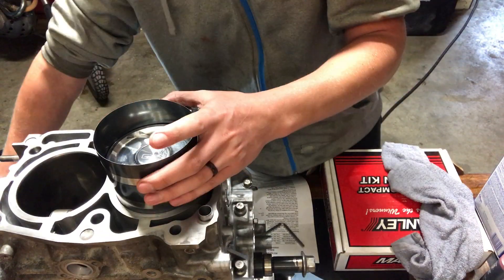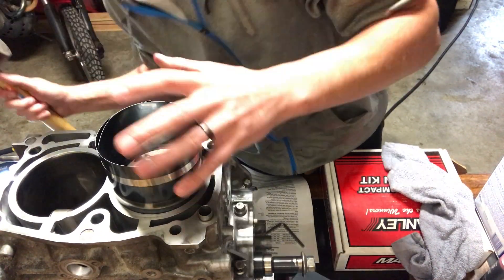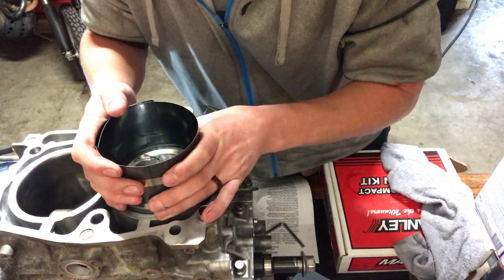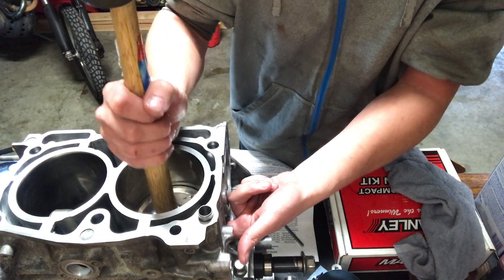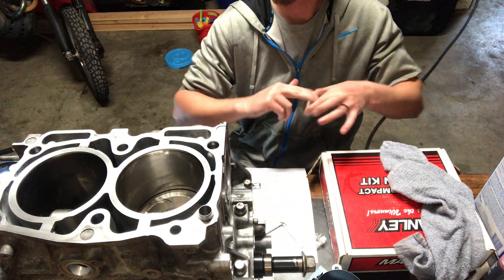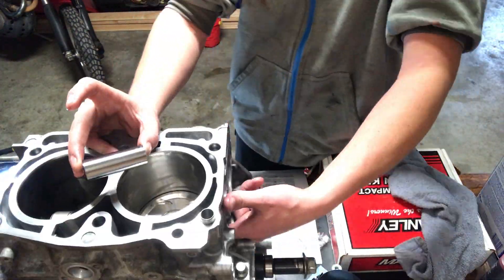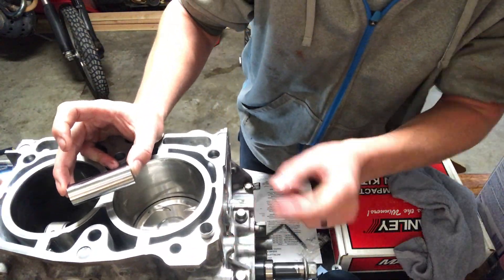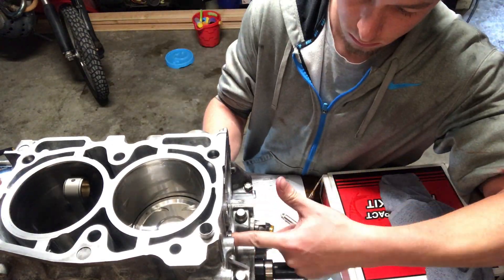You want to make sure that there's enough oil so that everything slides in there because it's not going to be getting oil for a while. Take the back of a hammer and tap it down once you get it into the compressor. It gets a little tough near the top but just keep working at it. If you hang up on anything it's best to stop, pull it out and do it again, because if you're pushing too hard on those rings they'll bend and break. You want to make sure those are perfectly round when you go to put them in, otherwise they're going to scar your piston.